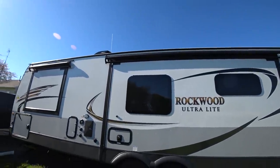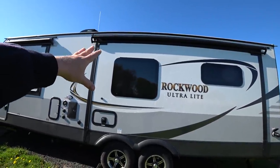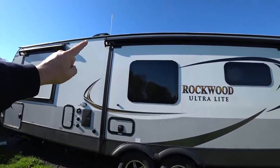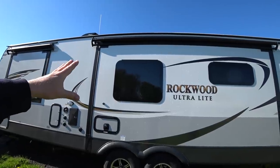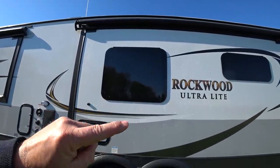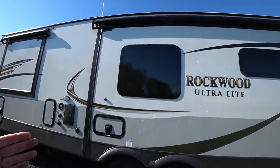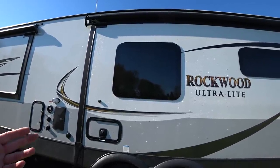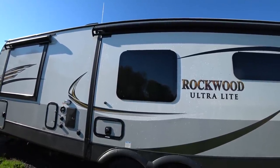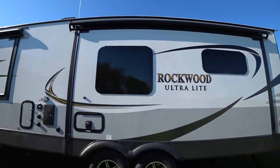One of the other things you may notice are the frameless windows — we love them. They're heavily tinted, they do a really good job keeping prying eyes out, and we opted for thermopane. Now, thermopane windows on an RV are not double-paned glass with inert gas like a house — they're simply thicker windows from the factory. They help a little with R-value but nothing crazy, and they give a really nice look to the outside.